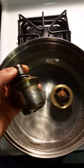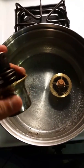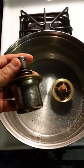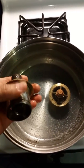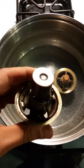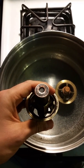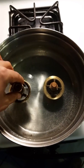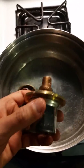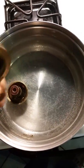This is the original 145-degree thermostat for the engine. I just pulled it out and wasn't exactly sure if it worked or not — the engine was running really cold. I cleaned it up a little bit; you can see '145 degrees' marked on it. And this new one I just purchased is rated at 160 degrees, located on the side.